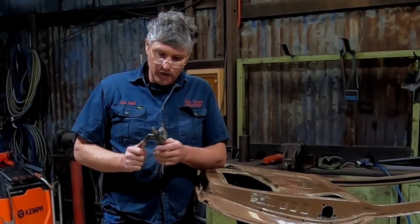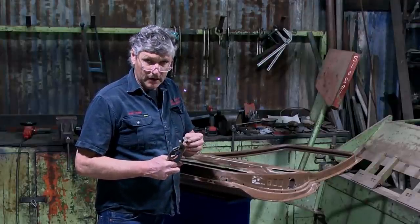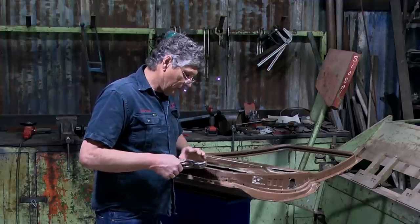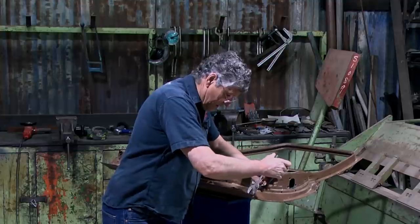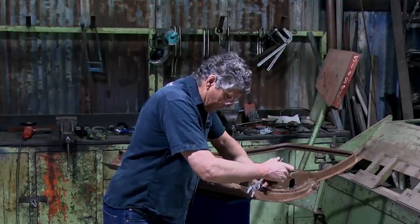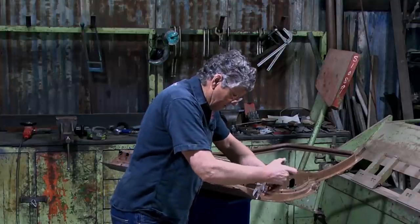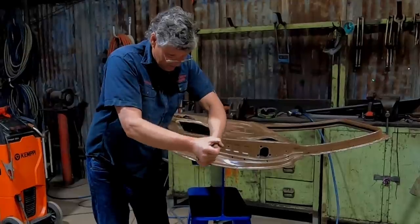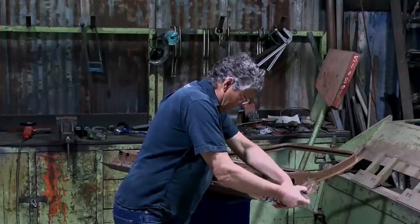This is how I do it. It's an old pair of multi-grips and I have welded this little wedge on the top of it — just a piece of eighth plate that I've cut and ground back to a point. It's not sharp, it's pretty blunt, only mild steel, but it's good to get into a skin under the crimp and you can lift it up. Naturally where you come to a spot weld you're going to have to either grind that away or drill it. With this approach you can open that crimp up, get the skin off the panel and then put it back on again.